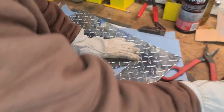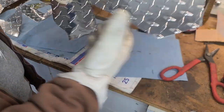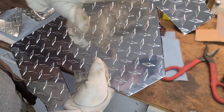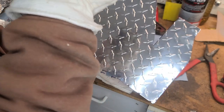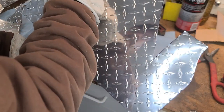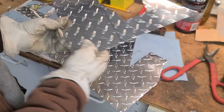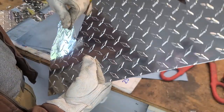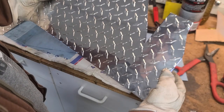You can see there's just a little bit of deflection on some of these corners, and you can bend that really easily. I don't want to affect any of the flat surfaces because I need a good mirror finish on that. What I'm going to do is bend this right along here so we can get that dip that goes underneath the harmonic balancer. Once we get that all mocked up, I'll be able to get good measurements about the angle created here so we can create that little chin strap section. The connections across here are going to be done with rivets.